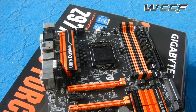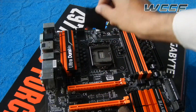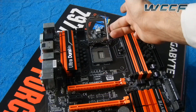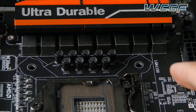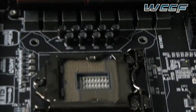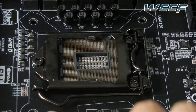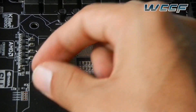I have already taken the liberty of opening the motherboard. You can clearly see the CPU socket. It's a very nice looking motherboard. The capacitors are actually durable black solid capacitors, which you can quite clearly see. These are the phase capacitors, which is 8 plus 4 for the CPU socket. The CPU socket is the LGA 1150 socket — it has 1150 pins, and do not try to put the 1155 processors in it because you will damage the pins. It's ridiculously easy to damage the pins in these motherboards.